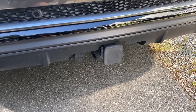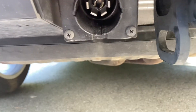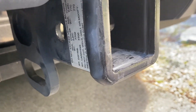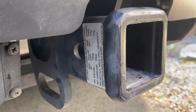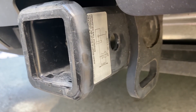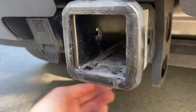This is the factory installed hitch on the Q8 — from what I understand it's very similar on the Q7. Going underneath, you'll see the connector for the seven-prong trailer adapter. Removing this cover you can see the receiver as well. One thing you want to check is what your trailer hitch is rated for — in this case it's 7,700 pounds and a tongue weight of 770 pounds. There is also some direction on the back here relating to the type of hitch ball mount to use, with some requirements as far as measurements are concerned. And of course this is where your chains go.